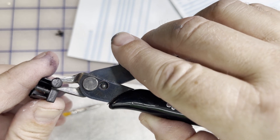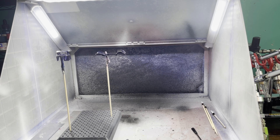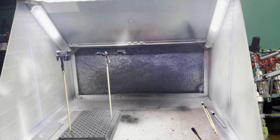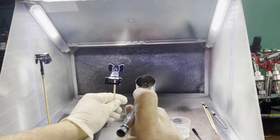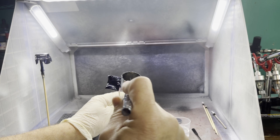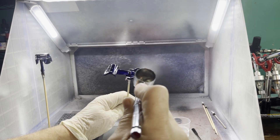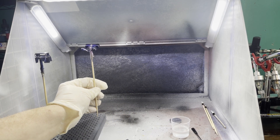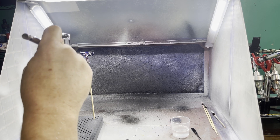I'm going to go ahead and cut the steering wheel off - I don't like these steering wheels on here, I like to use my custom steering wheels. I know inside you can't hardly see them, but it's just added a little custom touch. We're going to go back to the paint booth and shoot the 2K clear at this point. Make sure you use a respirator - 2K clear is no joke, make sure you got plenty of ventilation. We're going to go ahead and hit these fenders, give it a nice little coat. You want this to go on wet - you don't want it running, but you do want it shining, you don't want it going on dry. You'll have a much better finish if you do it this way. Looks great with just that first coat - when it dries it's going to look just as good. Now let's go ahead and do the body.